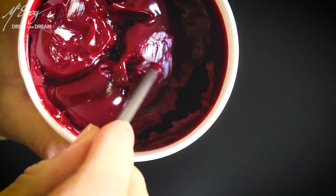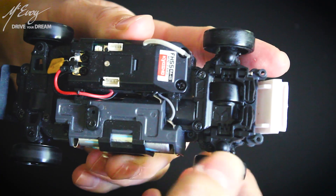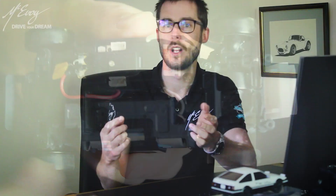After messing around a few hours with that, I moved to the thicker Castrol Red Rubber Grease. Essentially, Traxxas Marine Grease is exactly the same thing, except that it's more expensive because it says Traxxas on the tube. You get 10–15 grams in the Traxxas tube, while you get 500 grams in the Castrol tub for roughly the same price — that makes Traxxas' grease about 50 times more expensive. Think about that! Anyway, this thick grease requires a higher torque to get the differential effect. In other words, the diff gets tighter still, all the while retaining the openness required for a front axle. Personally, I find the setting to be spot on.